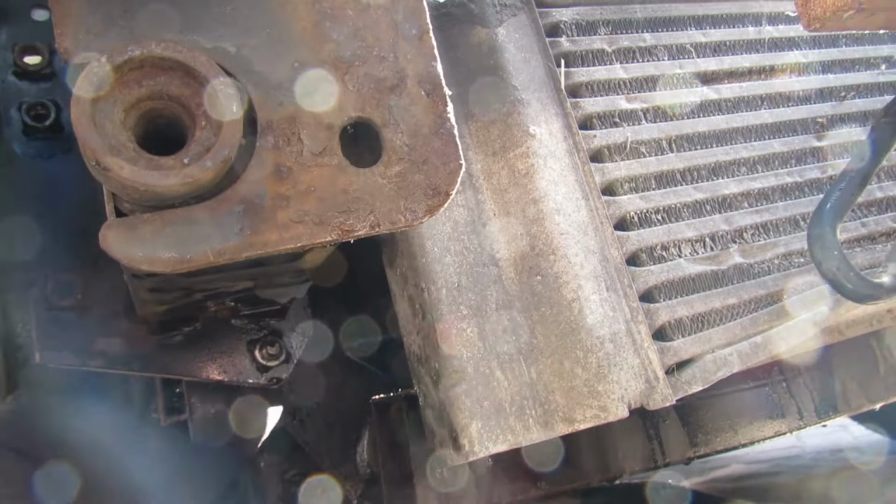What I'm going to do is just loosen these off. There's one there. It's a big one. They're coming off easy, so that means they're not torqued that much. What I might do is just loosen things up. I'm guessing maybe there's big ones here, but we'll take these little ones out. Now your new pump doesn't come with new bolts, so be very precious with these. And obviously we want to give everything, especially the surface that the new pump's going on, a very good clean.